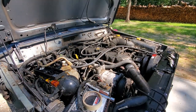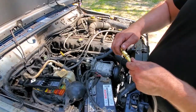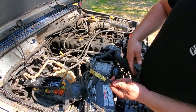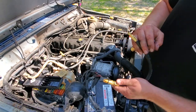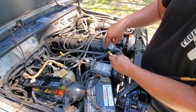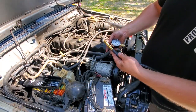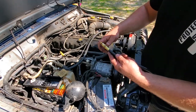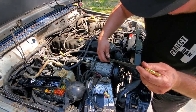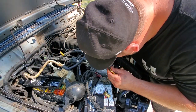All right, without further ado, the compression test. So I got my adapter that fits the Jeep 4.0. If you're wondering, yes, the Innova 3612 compression tester does fit fine in this head. It will not hit the pistons as it comes up in the cylinder. This is safe to use. So I'll leave a link in the description below if you want to get the same one that I'm using today.